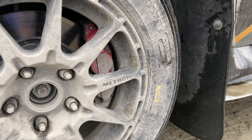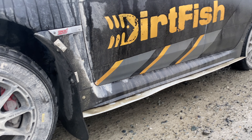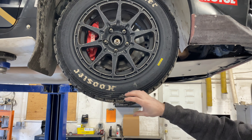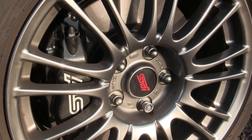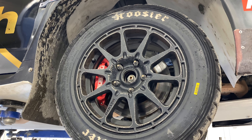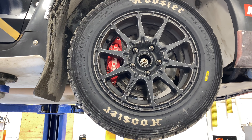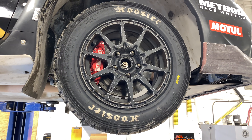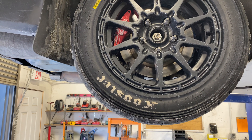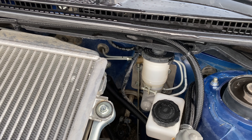From the tire, we move to the 15-inch Method wheels, which are necessary since rally tires are sized at 15 inches. In rally, the tire is an important part of your suspension — you need enough sidewall to properly absorb impacts from the brutal nature of rally driving. A thinner sidewall on larger wheels would mean more flats and more destroyed wheels. But as a result of smaller wheels, that restricts your brake caliper and rotor size. The stock STI brakes are too big, so Dirtfish replaces them with stock 06-07 Subaru WRX calipers for the front and rear, Hawk brake pads, and downsized rotors. The brake booster is also removed, replaced with a new master cylinder providing a more consistent pedal feel, along with custom brake lines.